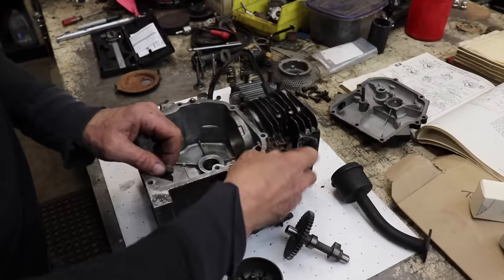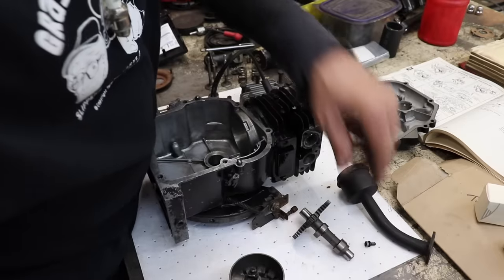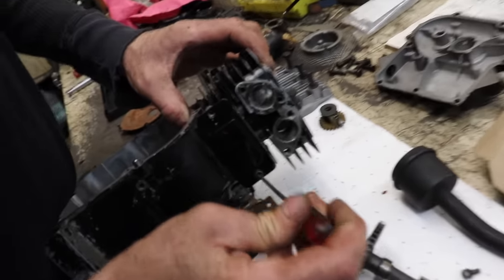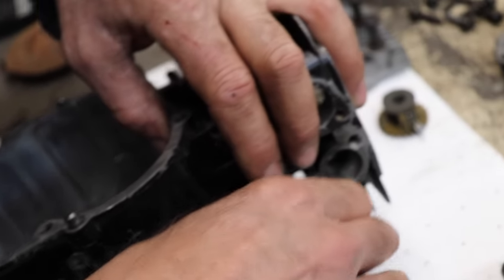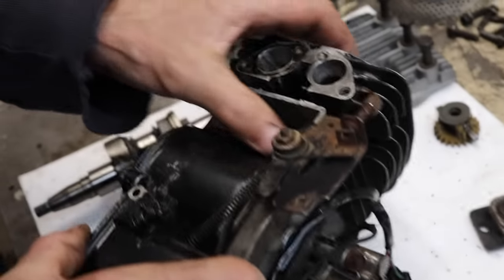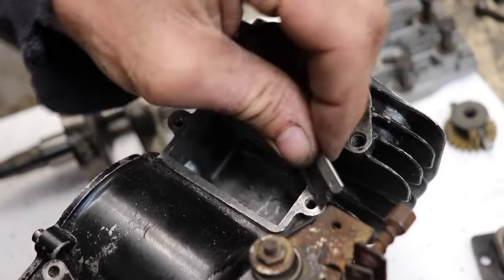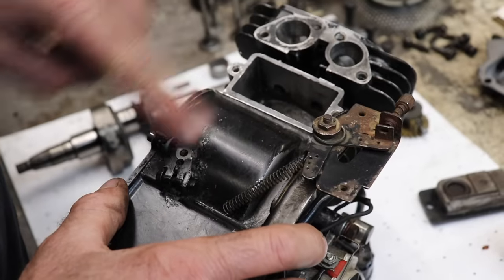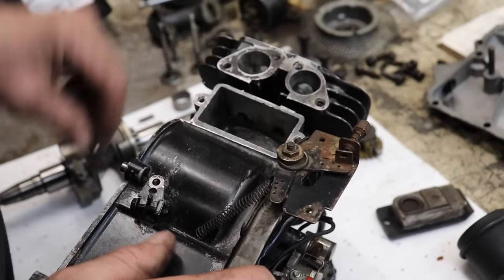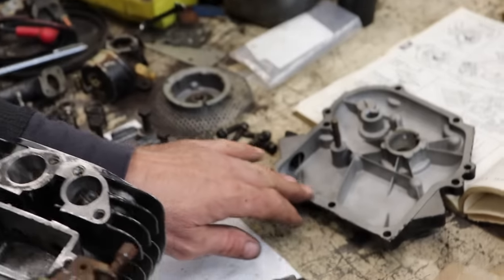And we'll take this valve cover off. Gonna replace that gasket. You want to replace all the gaskets, so you might as well just get a gasket kit. But luckily I looked in my stock and I had everything in stock, just about. There were a couple things I had to order that were missing. I had all the gaskets. I didn't have a gasket kit, I had them all individual. I had all the seals. The governor arm that goes on here was missing, I had to order that. And a couple of little clips and stuff that hold this governor spool on here were missing.